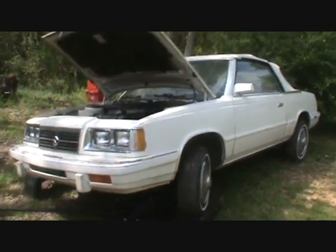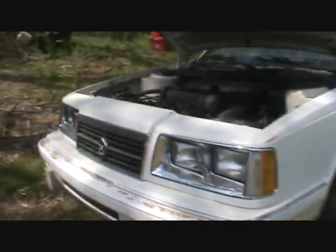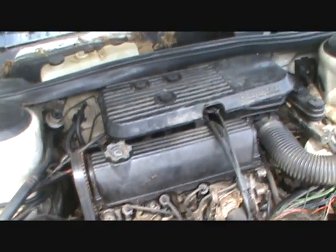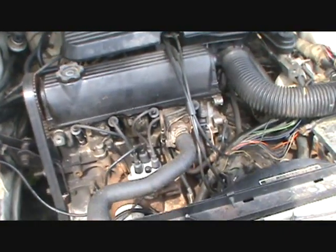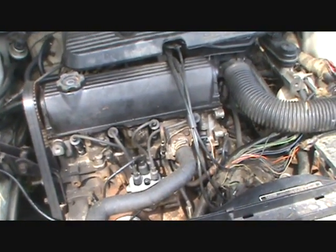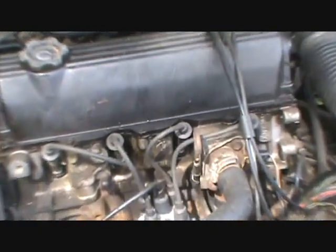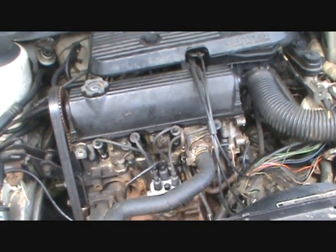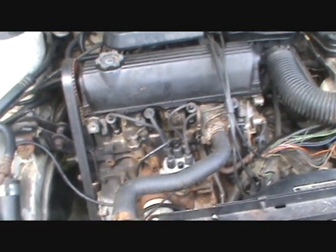Today's the day. This car has been in a few other videos — it's an '86 Dodge 600 with a fuel-injected 2.2-liter engine and a three-speed automatic. It's only been running sporadically and when it was running it wasn't running well. It's lost compression on cylinders three and four, so it's either a head gasket issue, a valve issue, or something worse.